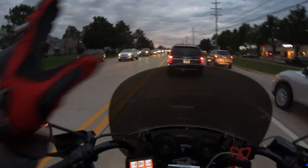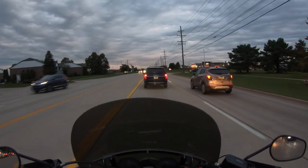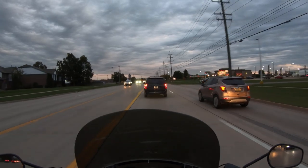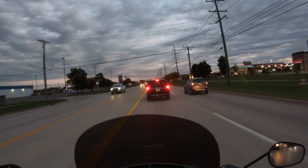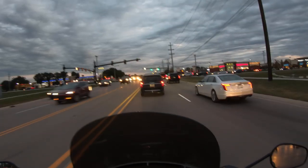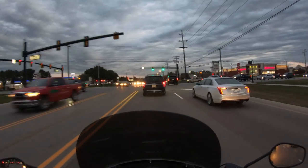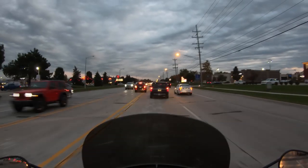So to put this whole situation together, the reason your Milwaukee 8 is sumping is because of pressure and because of oil being thrown. When you have pressure in the system, oil can't escape through the hole, so it's throwing the oil everywhere, and you're not getting any oil back to your pan, which is where your oil gets pumped back through your motor. And so your crankcase has the oil in there, but it's not getting back to your system to run through everything else.